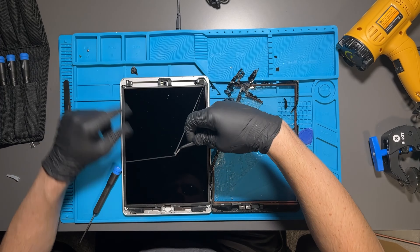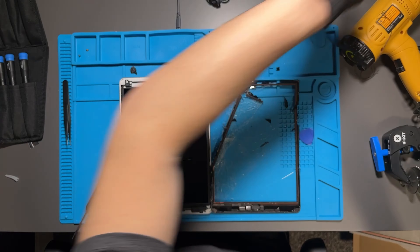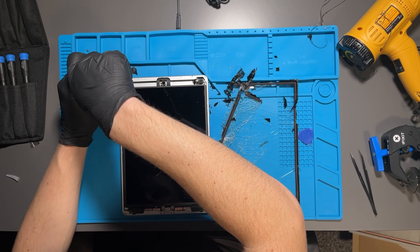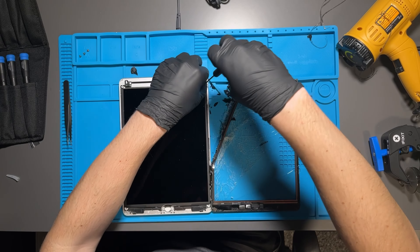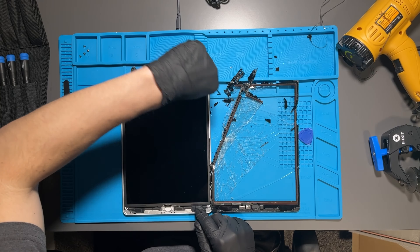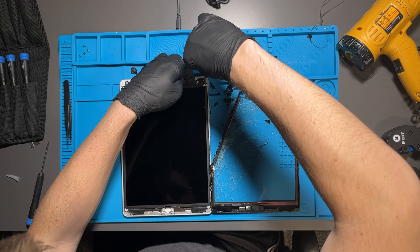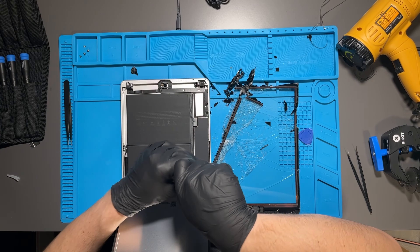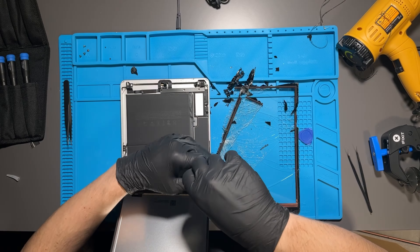The two screws up at the top of the LCD are hidden under little pieces of tape, so use tweezers to pry away the tape around the screen to reveal those screws. They're all the same size, so you can group them together. Once removed, pry from the corners to lift the screen — tilt it forward and pry at the corners where the metal is. Don't pry in the middle or you'll likely crack the screen, which is a much more expensive repair.